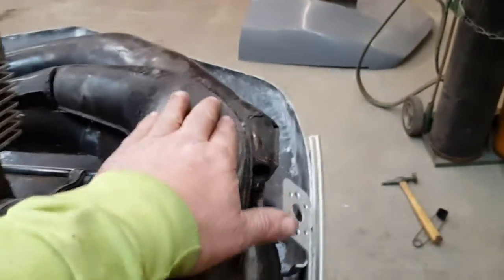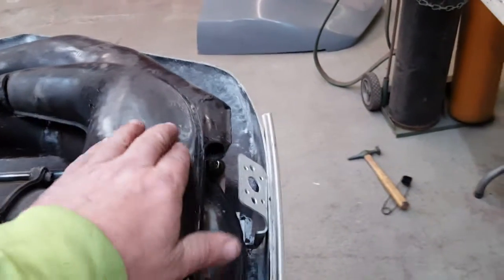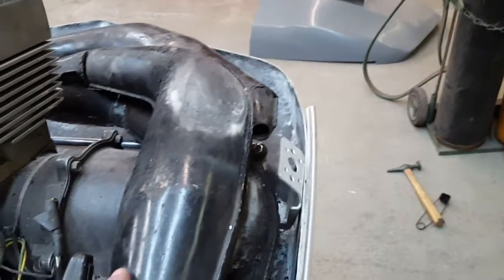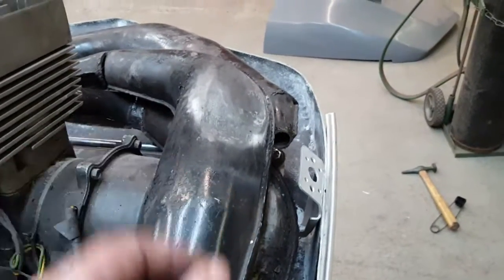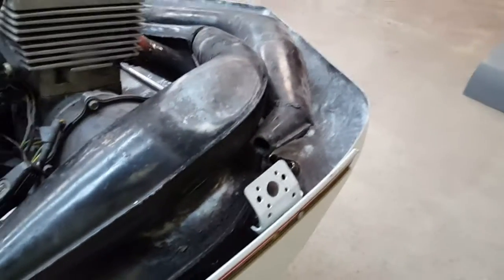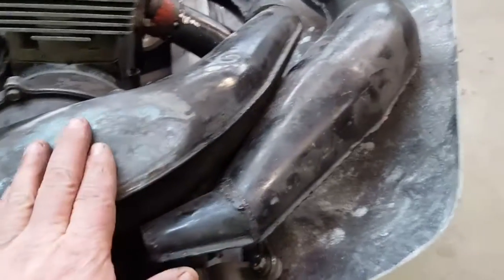So I had to kind of ease that. It looks probably worse on this video, but I only worked it down maybe 3/8 of an inch in this area to get a little extra clearance on the hood. The last one I did, I didn't give a lot of clearance, and I bubbled my paint right away the first ride. So a sponsorship sticker ended up going in that spot, and some heat tape underneath. Lesson learned. So I'll give myself a little bit more room by easing this pipe down.